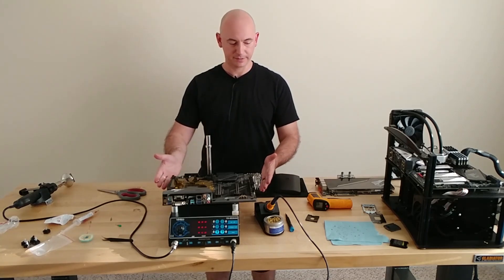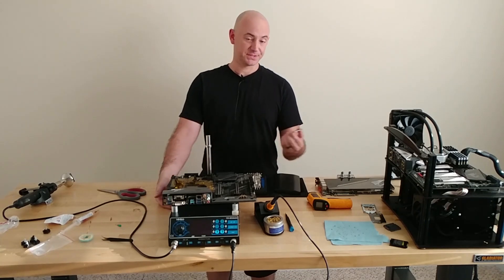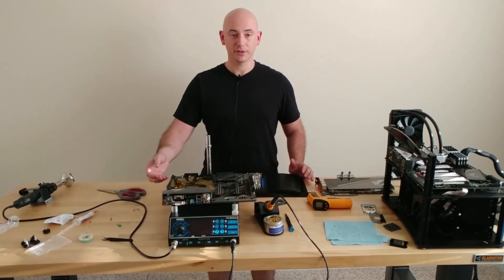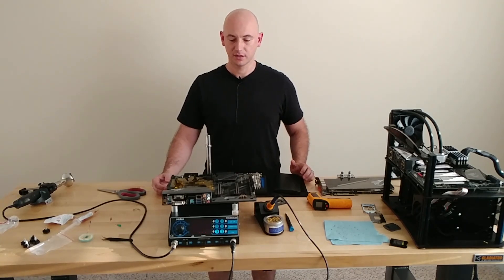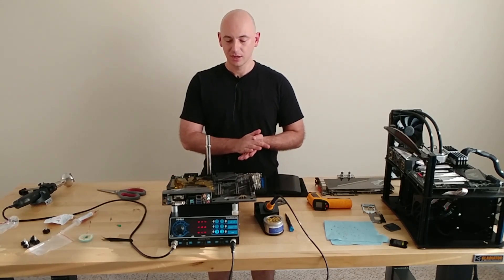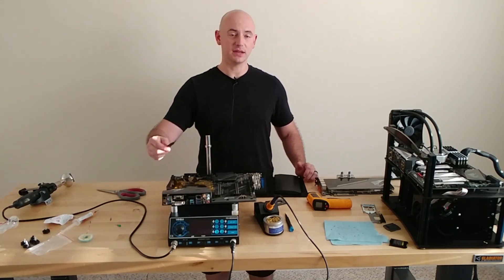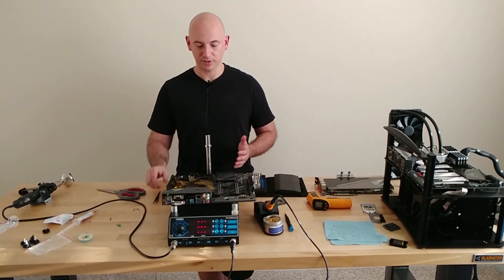So here we are back after giving that a try. I was able to get the socket off of the motherboard after some effort, set it to about 250, and the temperature in the reflow area was about 150 because I have that extra space in between the reflow platform and the motherboard. I added some spacers under there so I didn't have anything sitting directly on soldered components on the bottom. Unfortunately, that caused the temperature to be unreliable. I increased the temperature to a point where I believed it was maybe too high, and then I was too forceful with the tweezers trying to grab it off, and ended up pushing it into those resistors in the center of the socket. That pushed all of those to the side and made it pretty much unusable.